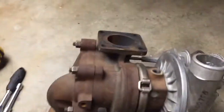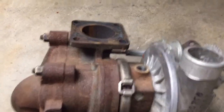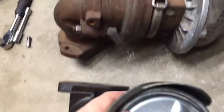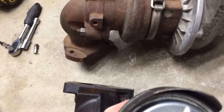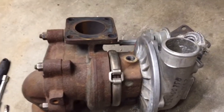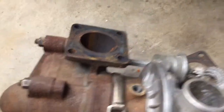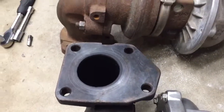The plumbing spot's a little different, but that shouldn't be an issue. The big difference though is that on this 2.5 engine, this is the exhaust manifold which is pointed down. If you look at this one, the exhaust manifold is pointed to the side. So they mount differently, and I was initially looking at it going, oh, maybe I can make this work out. Because if you look here, that's our flange bolt pattern, and it's very, very similar.